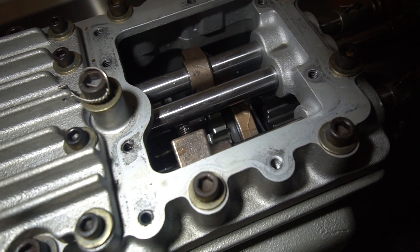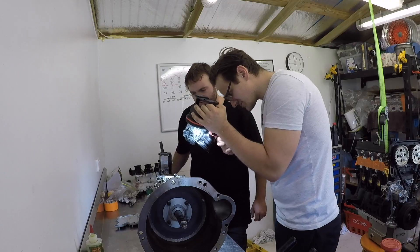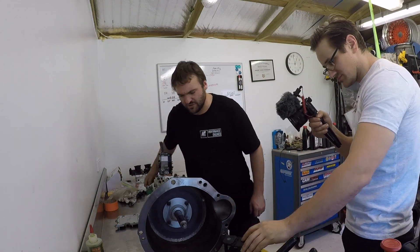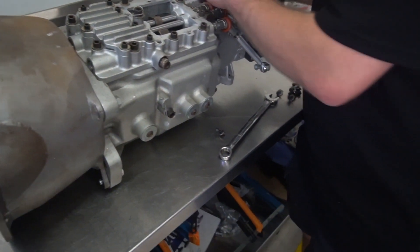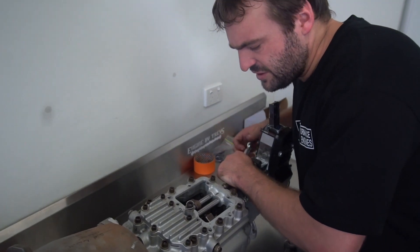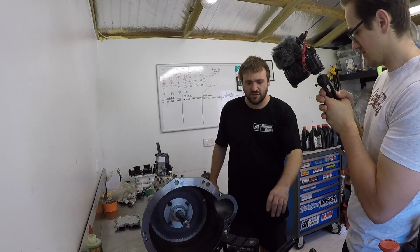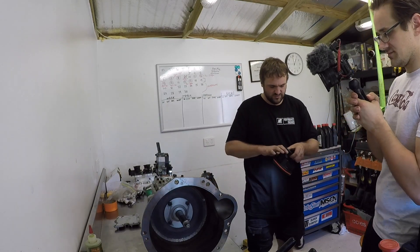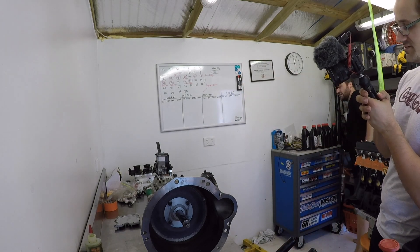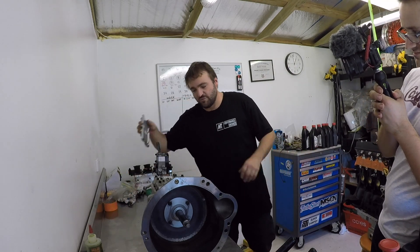That's how they operate. The dogs work on a backwards taper, unlike a synchro. They're also referred to as a crash box. They do make a lot of noise and they are violent on their shifts. But it'll be an experience to put one of these behind a 4A. It will take a lot of horsepower away from the car - if it was aspirated, this gearbox would barely... the car would almost not move.